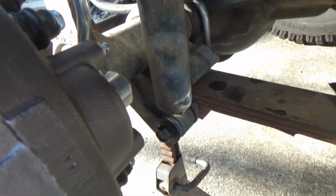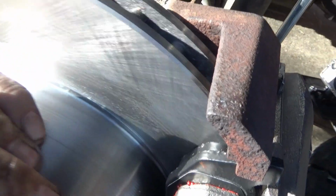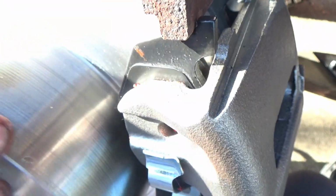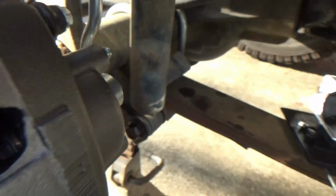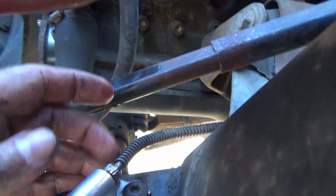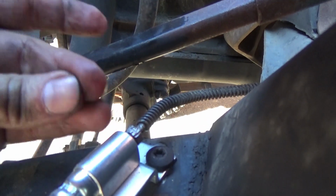Now what you want to do is check all your connections. Where we're bleeding the brakes, it's going to be under pressure, because now the disc doesn't spin as free, because you got just a little tiny bit of drag where the pads are seated against the rotor now, as it should. So we're going to look around here with a banjo bolt. Got no leaks here. Look up here. Okay, rub my finger underneath there, around here. Got no wetness. Good. We're good there.